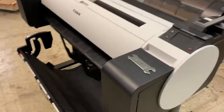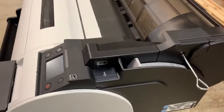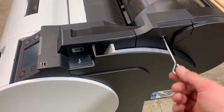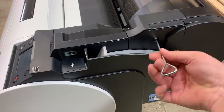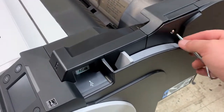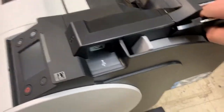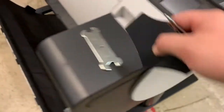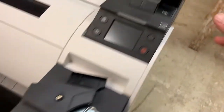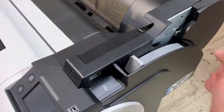If you purchased the TM305 MFP, the next step once you get the machine assembled is taking off the covers on the left and the right hand side. There is one screw on each side that is taken off with the supplied wrench. Make sure you keep the cover and the screw because once we put the side adapters on that hold the scanner, we're going to put those covers back on.